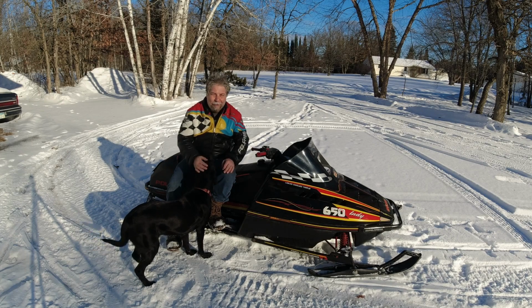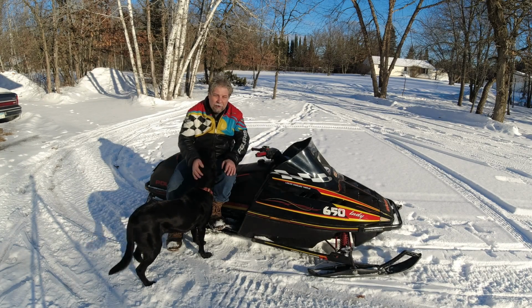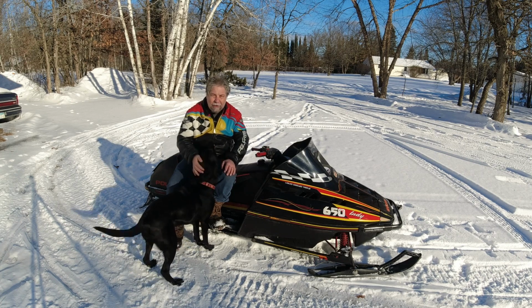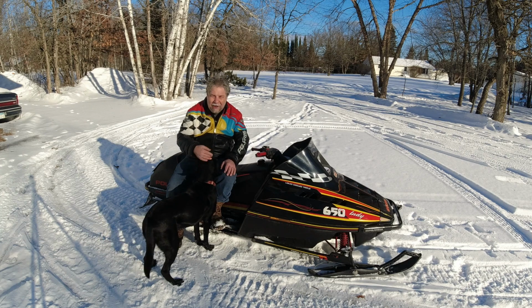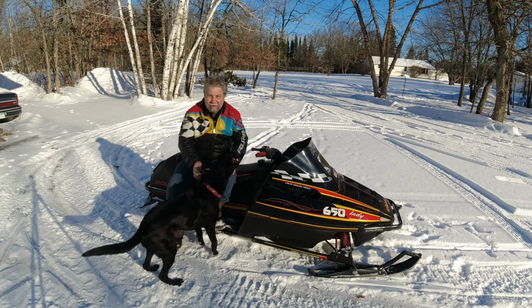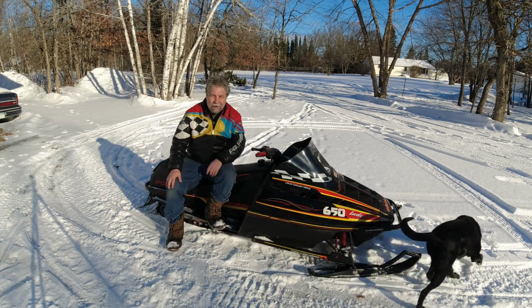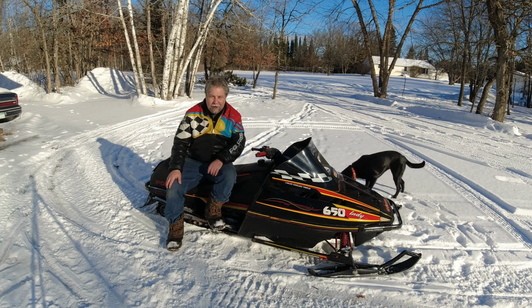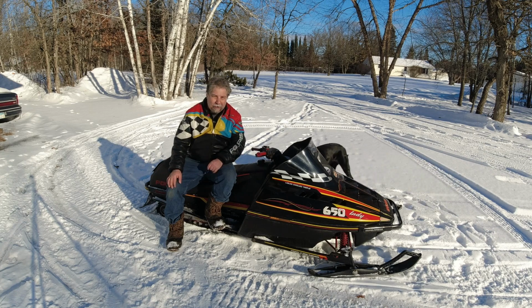So all I can say after those test hits is, wow, she's crisp, spot on. So I got her clutch to engage at 5,000, right on the nuts, and you can see I could hold it right under there, hit it, zero bog, right out of the hole, super snappy, skis up, when I got traction anyways, skis way up. So she hooks up good on the hard pack, a little less good on the ice. It's got trail studs, not ice picks. It's a trade-off you make.